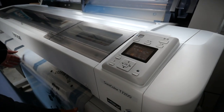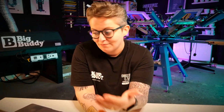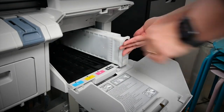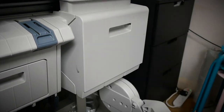The second part of Rick's question was, do you have to use it all the time to keep the ink flow in a happy place? And in my opinion, I think that is the truth. You do need to be using the printer a lot, and then the maintenance just drops off because the ink is flowing through anyway. There isn't any room for clogs. And then all you're doing is maybe replacing a maintenance tank once every six months or so, refilling the cartridges, which you'd have to have done anyway. So that's the reason why I think we have no maintenance on our printer whatsoever, basically.